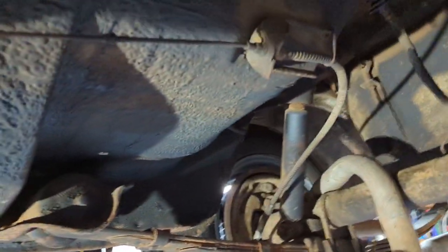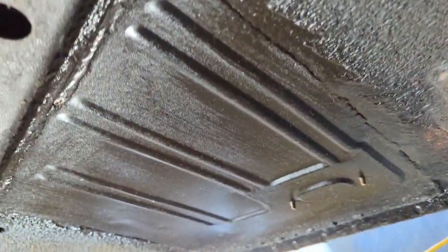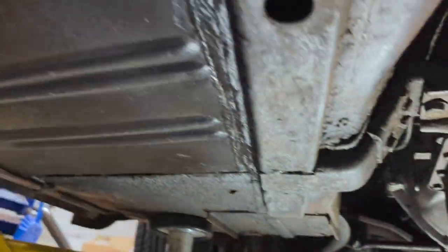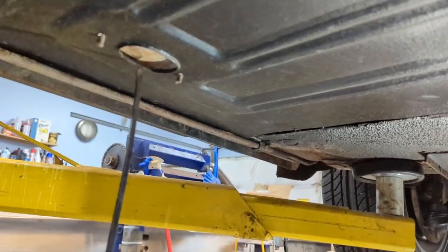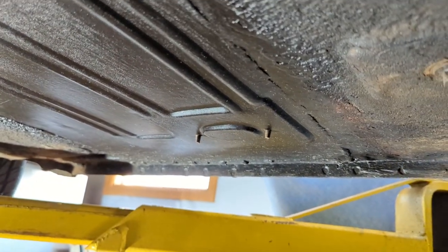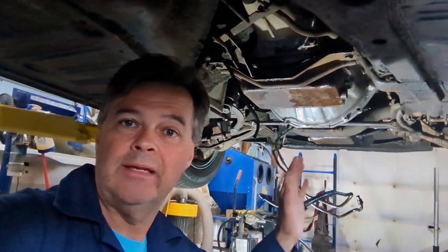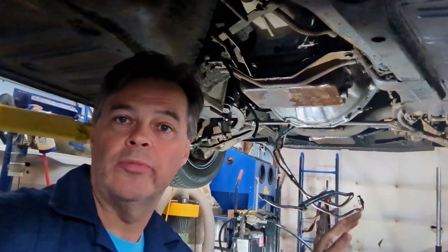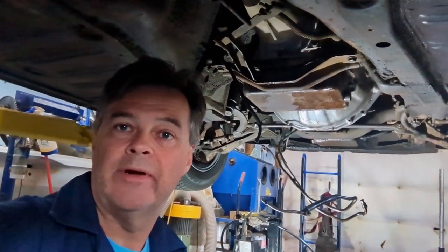The car is in really nice shape underneath. Here are the floor pans I put in — I want to get some undercoating, as what I put on was thin and I'm not happy with it. That's it — I think I covered just about everything. Remember: don't crank those bell housing bolts in if it's going hard, there's a problem. Make sure the torque bolts are through the flex plate — you don't want to do all this work and then break the bell housing on the last little bit. If it's going hard, stop and find out why.